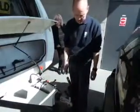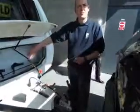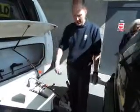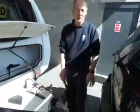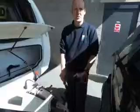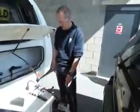Okay, that is a stabiliser hitch. On the older car, you used to have the bar down the side of it, the leaf spring. That replaces that. What it does is use friction on the tow ball. So the tow ball needs to be grease free, so it needs to be dry, and obviously paint free, so when they fit another one, they'll take the paint off.